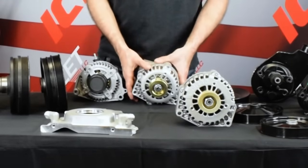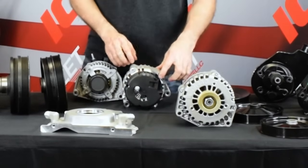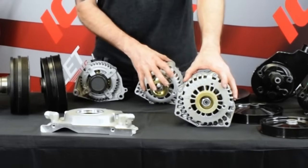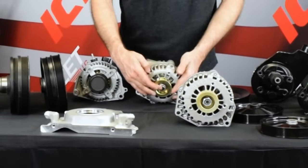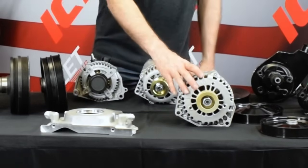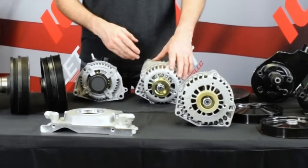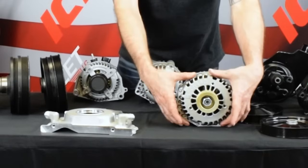This alternator here is a 105-amp alternator — it's the only alternator out of all the trucks that has this rear mounting tab. None of the other ones have any bolts back there. And then this is a 160-amp truck alternator. It has the same bolt pattern as the 105-amp, but it's a larger case — bigger diameter and deeper as well — which won't allow you to bolt it in front of the head. It will not fit; it's a little bit too deep. These both have the same connector plug, so they're interchangeable there. It's just this pulley is raised up in the case because the diameter is larger, so that'll make your belt length longer as well.